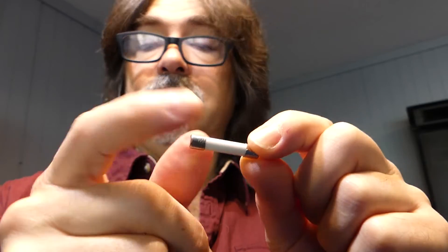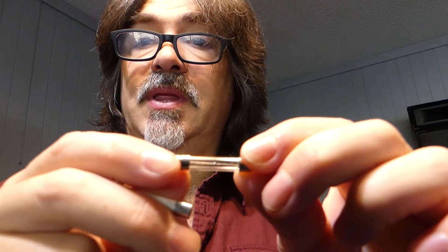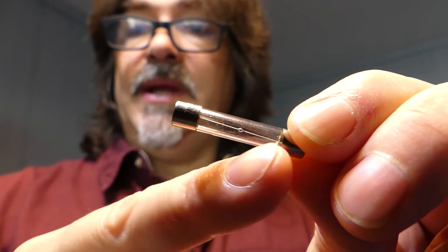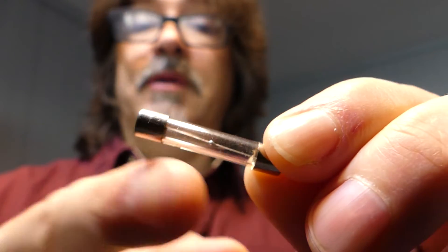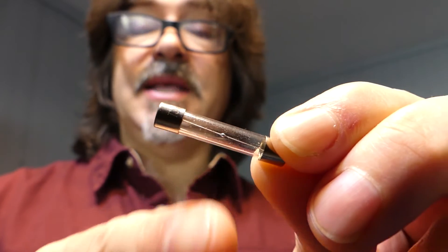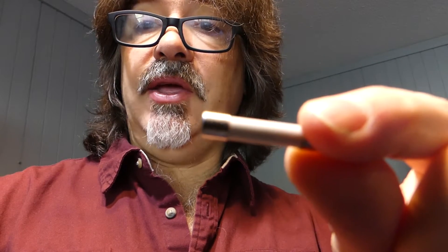This one is white — you can't see inside of it, so you're going to have to use a tester to see if it's blown. This is a different one that's clear. If you take a close look, you can see there's a little filament in there. When the fuse blows, that'll melt and be broken, or the fuse will turn black. So if you take the fuse out and see it's melted in half or burned inside, it's probably bad. This white one you can't tell — you're going to have to test it.